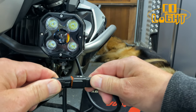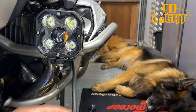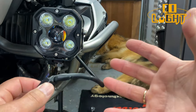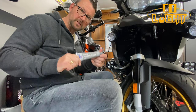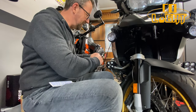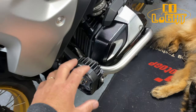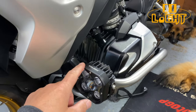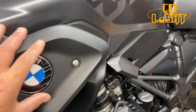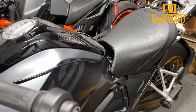Feed the cable to the back of the bike through the bodywork - you can do that yourself depending on what bike you've got. Keep all cables away from direct heat from the engine and exhaust - you don't want to start melting the wiring. Use an appropriate amount of zip ties to keep everything nice and secure. One thing I'd recommend is applying some dielectric grease on the plugs before you push them home - that helps keep the water out.